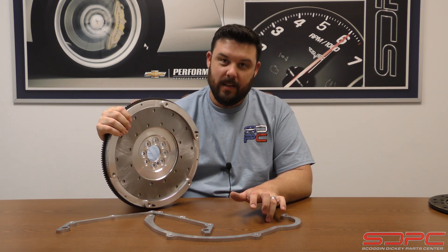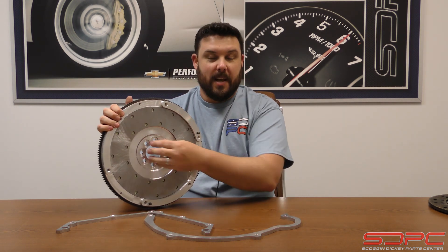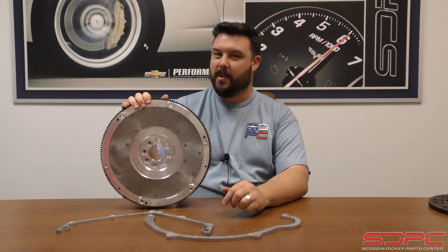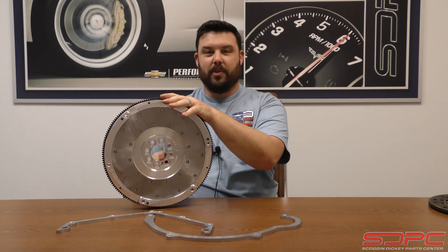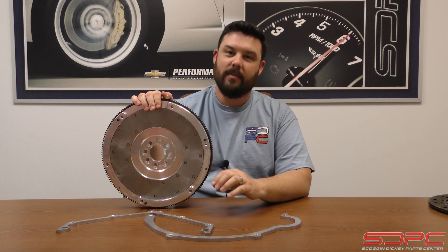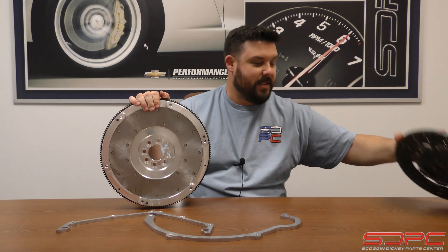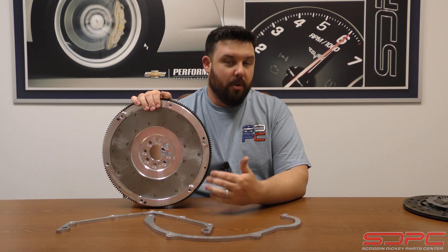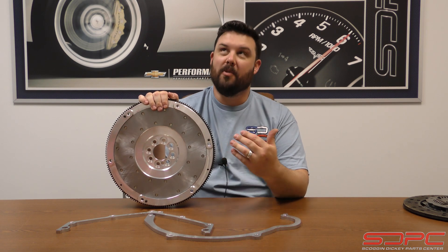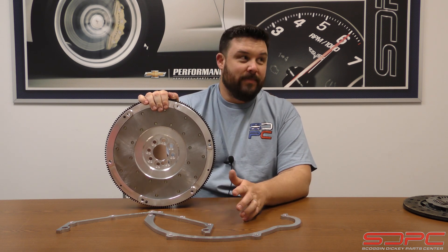This is actually part number 2558. They also make a 2558F — don't get that one. It's flat like an old LS1 style; you don't need that. That's actually for LSA patterned twin-disc applications. This is something pretty trick that I don't think a lot of people know about: this is LS7 clutch to 8-bolt LS and LT crank. It will work with 4.3, 5.3, and 6.2 — maybe if you're not going too crazy on power — and you can use a nice cheap single-disc LS7 clutch from us. That is a good deal. LT clutches can be pricey even if you go with the stock ones; they actually made some great ones from the factory, but they are expensive and kind of hard to come by too, because not a lot of people took them off to upgrade — they were so good.